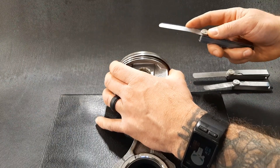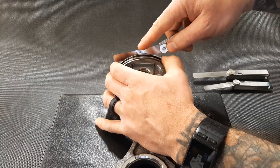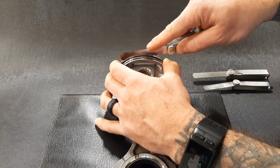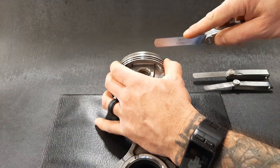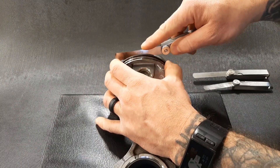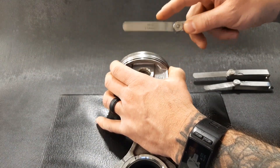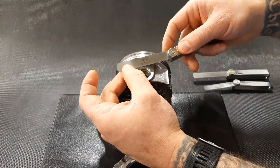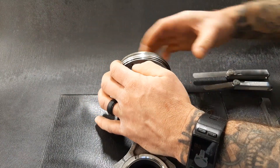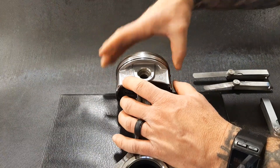Moving on to our second or middle compression ring, we're going to do the same thing — lift the ring up, slide the gauge in, seat the ring back down in its groove, and drag back. Two things to note: number one, I've got to pull much harder to get this feeler gauge back, and number two, once the gauge is in there, I can't seat the ring all the way down in its land. So this is definitely tighter than one and a half thou. Unfortunately I can't actually measure it because I don't have anything smaller right now, but given that seven tenth thou is our lower spec, and the fact that I can feel it moving up and down, and this is basically a brand new piston, I'm sure we're well within spec.